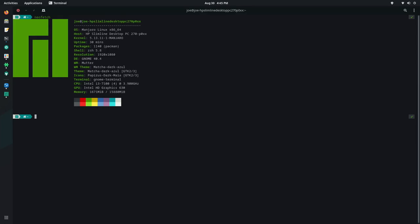I bought just a 550, and you think, well, that's not even worth having. Well, it works really well on Windows, to be honest with you. I can encode 4K 30 on Windows, no problem. 4K 60 will peg that little graphics card out because it's a low profile one, 550. It's got 4 gigs of VRAM on it. I mean, it's just perfect for what I would need it for.